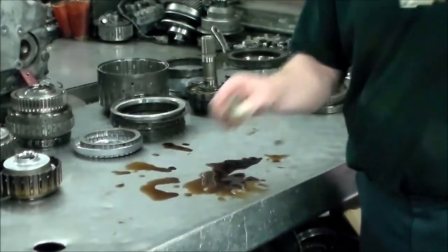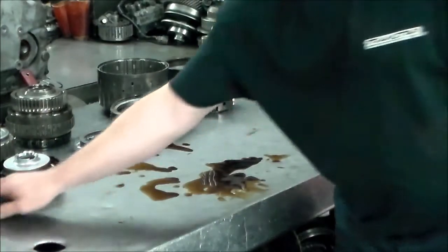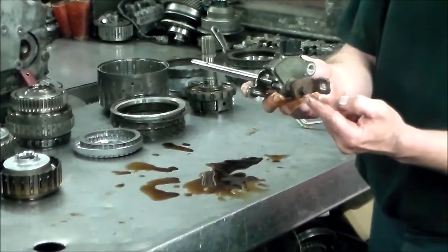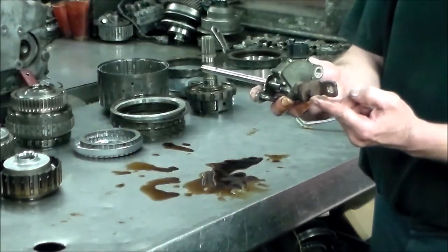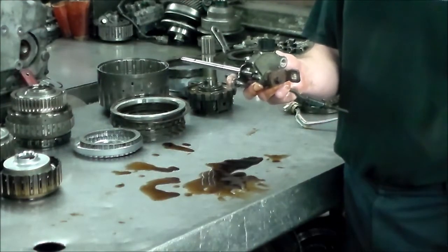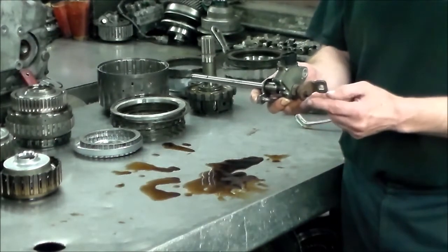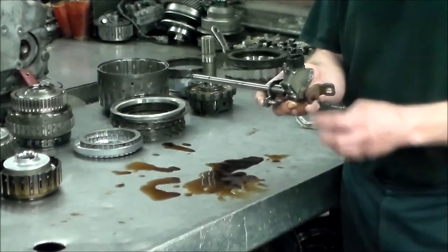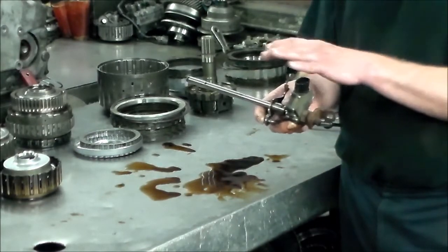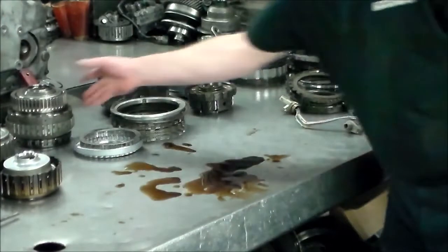And here again on the harnesses, I'm going to show you the case. This is again the only one that takes two harnesses. Here's the linkage that I took out. I elected to take this whole thing out as one because a lot of times when you try to get this nut out, it's going to break. The Lexus that I just had, that actually happened. So one of the things I had to do, which I did make a video on, was replacing the pump, replacing the linkage, taking the valve body off, putting it back on, and replacing this arm with a new washer and nut. So I had a feeling that this was probably going to break, so I just elected to take the whole thing out, and I'll just put the whole thing back like this. All right, so let me get the case up here.